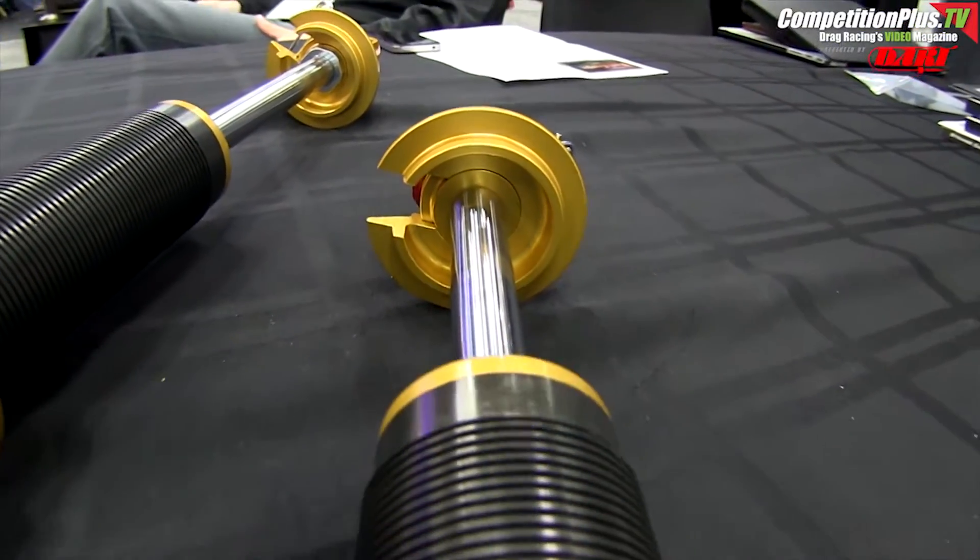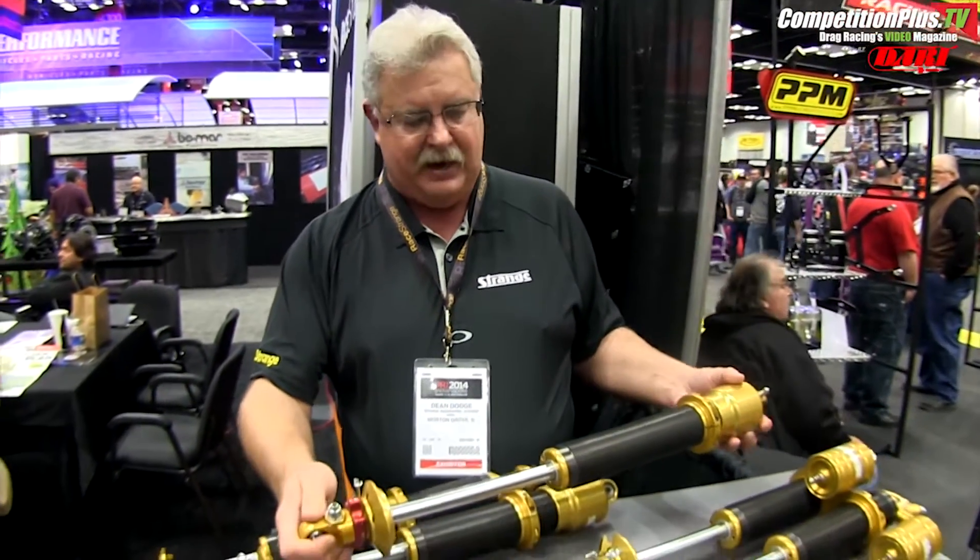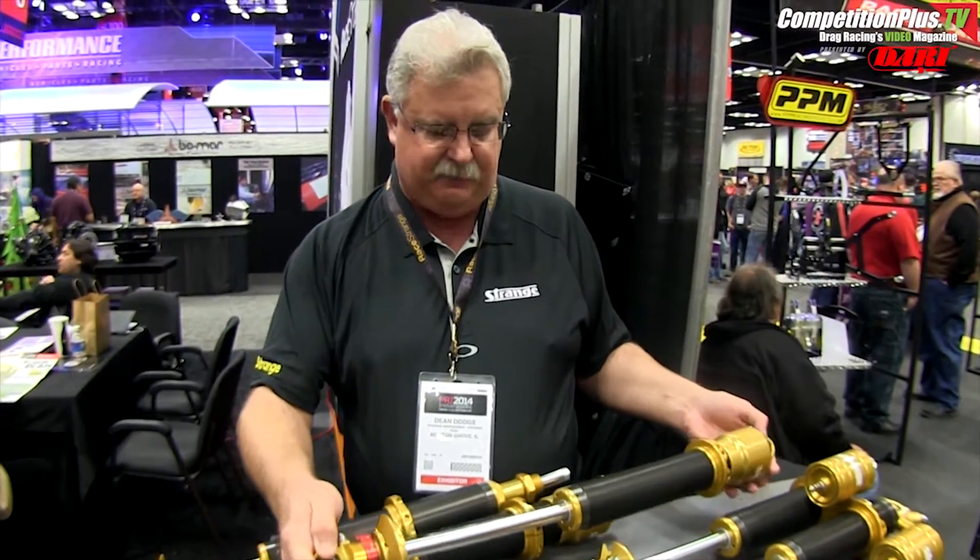Very lightweight, hard anodized, with very low friction and a very unique design guide, seal, and piston band. We also have a two-way adjustable with a low-speed compression and a high-speed rebound, which is a better function for dirt track and oval track applications at higher speeds.